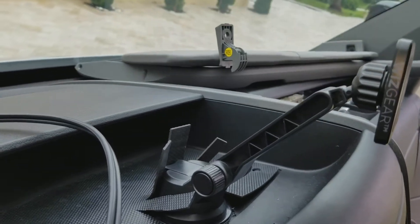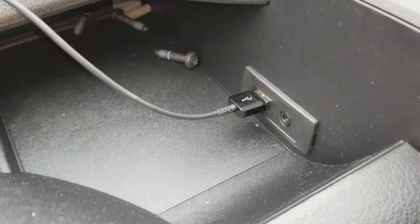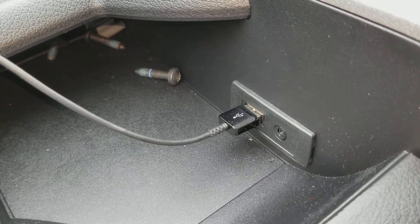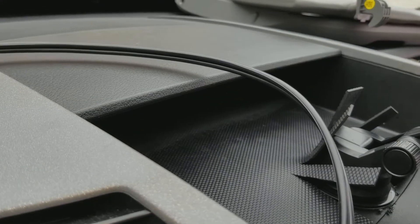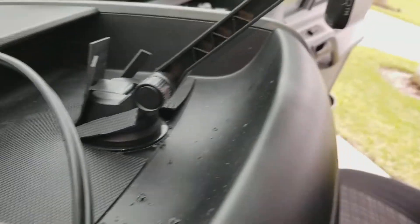The tablet is going to Miracast to the TV. I also use the stock USB port for charging. I found out the 3.5mm phone jack does not work that great — if you can link to the radio with Bluetooth, that's probably a lot better. I have this 12-volt power cable coming out, and I'm going to put an external adapter here. I couldn't embed a full plug — it was just too big — so I'm just going to put an external one right out here, and that will allow me to charge.